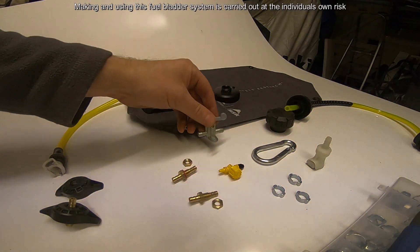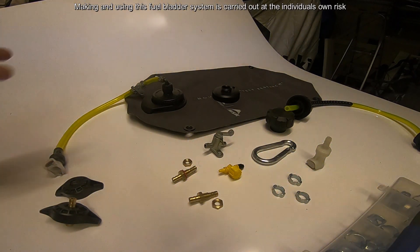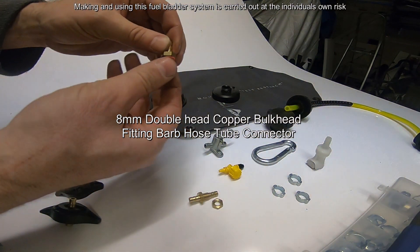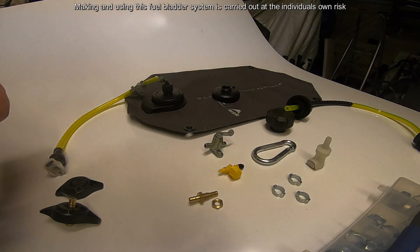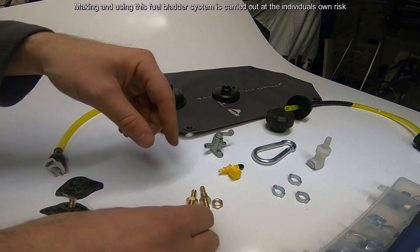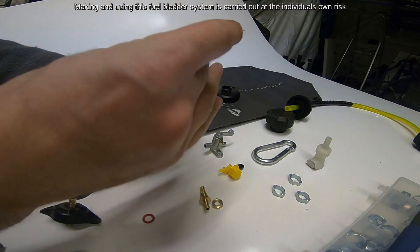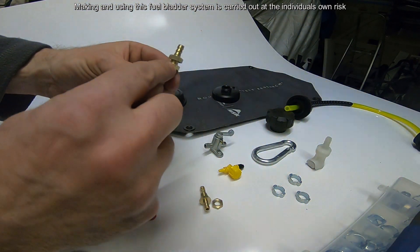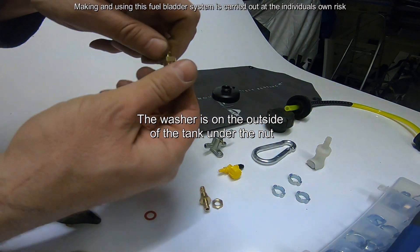This is the on-off valve I'm using. I'll put links in the description for all the components so you haven't got to go hunting around — I don't get anything from this, but I'd rather you guys have at least a fighting chance. These are the barbed connectors — the tank fitting connectors. I'm showing here a fibrous washer. The vent coming out shows the barbed connector that is in the tank. What I did was feed a bit of wire through the hole I drilled, back out the cap, fed the connector on, pulled it up through, and then put the nut on with the fibrous washer on the outside. That way there were very few options for fuel to get past — if the nut was on there it would start to leak out through the nut onto the fitting, so I thought it best to do it from the inside out.